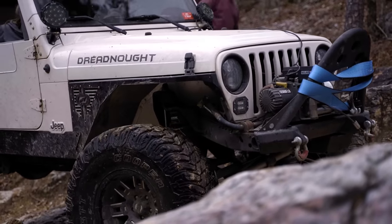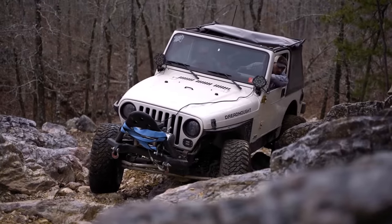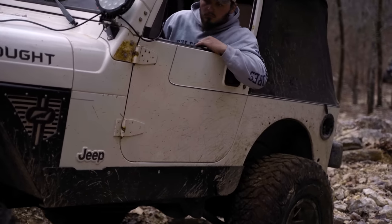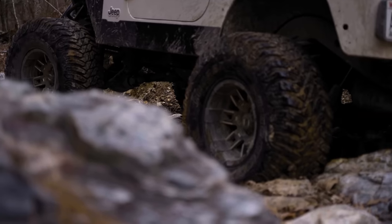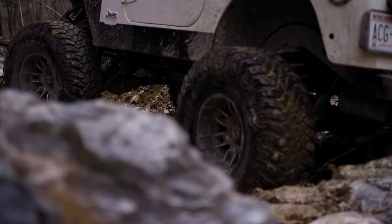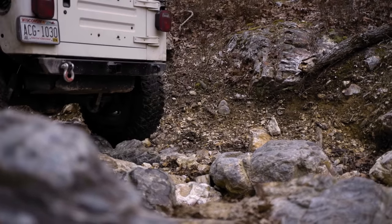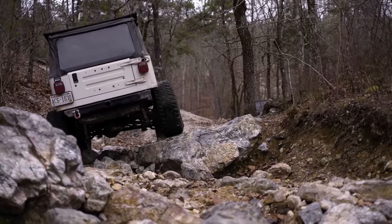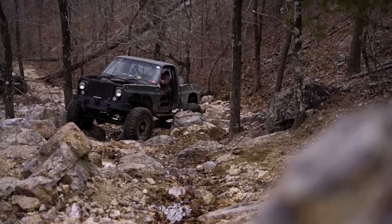More rolling mass or weight means more negative impacts to your suspension handling, braking, acceleration, and drivetrain components that your vehicle is not designed for. We might be able to get away with running the factory axles if — and that's a huge if — we're super careful, but the chance of breaking something in the drivetrain is still going to be pretty high. At some point you won't be able to crawl an obstacle anymore, and if there's no bypass, the only option is to throttle your way out of it, and one wrong bounce and parts will be flying everywhere.